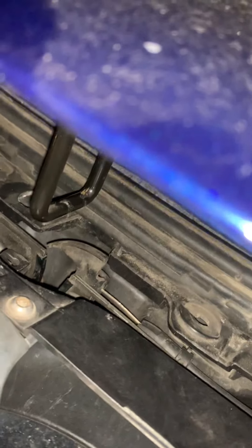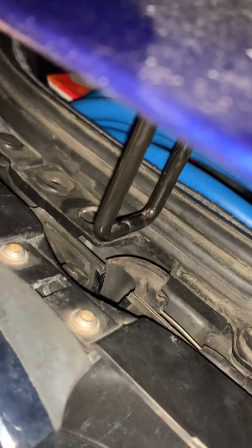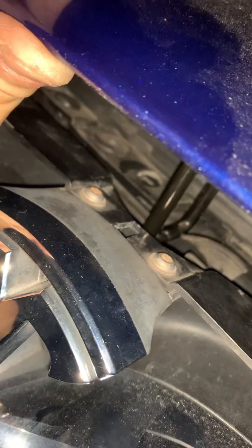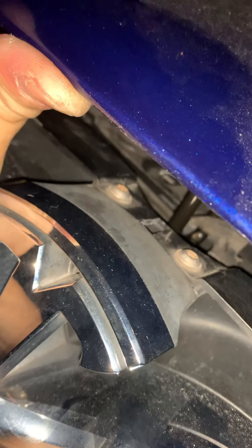To check it, it's very easy. In our car, we can demonstrate how the latch is hooked — the striker is hooked by the latch. You can see from here it can hook by the latch and will not let go if the car is driving and something hits the button. Of course, if you try to unlatch using your key fob, this one will let go at the same time as the primary latch.